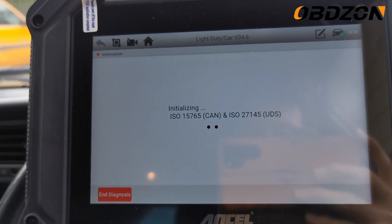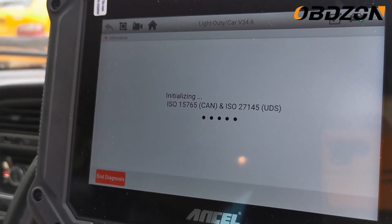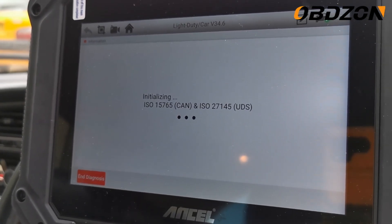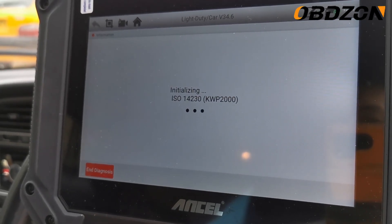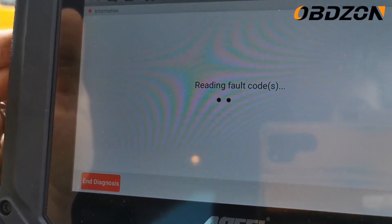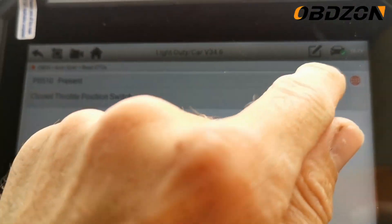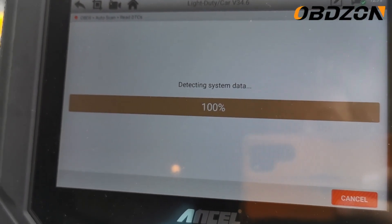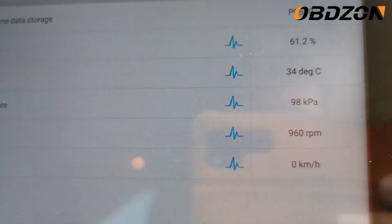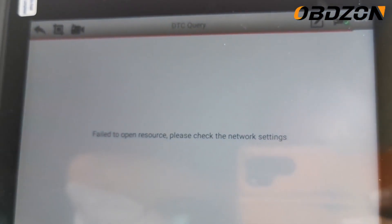Let's try the 306 — these ECUs are a little newer so we should get in no problem. We might not reach ABS or airbags, but it should certainly get into the main ECU, which is a Bosch EDC15, via OBD2. And there we go — we're in. It's telling us we've got one DTC stored, saying it's a spark-ignition type which is wrong, but nothing's perfect. The closed throttle position switch is present and faulty — I didn't know that. We can collect freeze frame data from that, which tells you exactly when the fault occurred, the vehicle speed, and engine RPM at the time. Very useful.